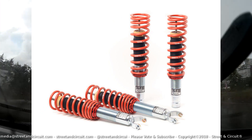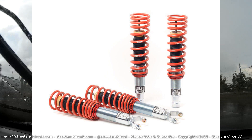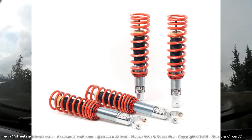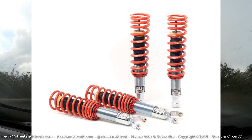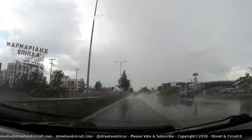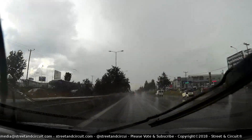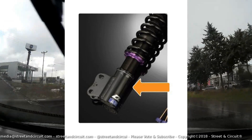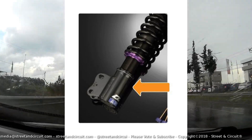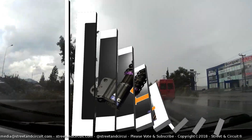So in a way it's a blessing in disguise — with the coilovers without an independent bottom mount for height adjustment, you can't really go too far wrong with setting the ride height at its optimum for performance. On the other hand, if you've got a coilover which has an independent bottom mount for height adjustment, I see no reason why you would put any preload into a spring for a road car. I'm talking about linear springs here, not progressive.